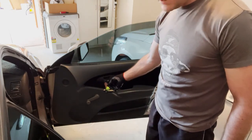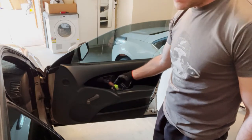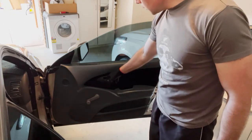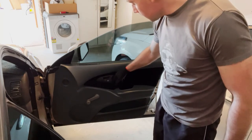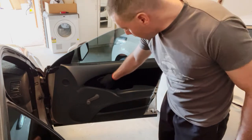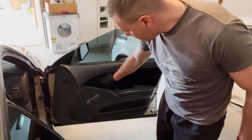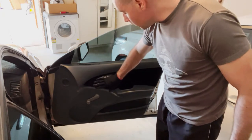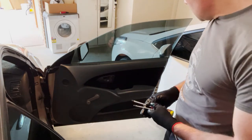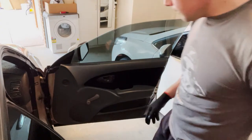Be very careful with the door cup because these are susceptible to breaking — they're quite fragile and increasingly difficult to source. It normally breaks around this area, and if you screw it on too tightly you can break it where the screw fits. So just be very careful when removing or replacing the door cup. There's also a screw in there, so we'll get started.